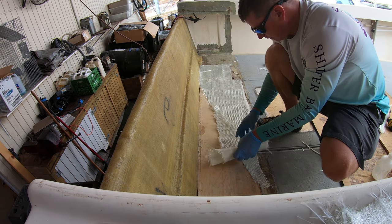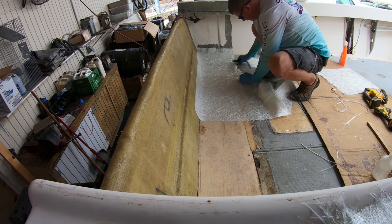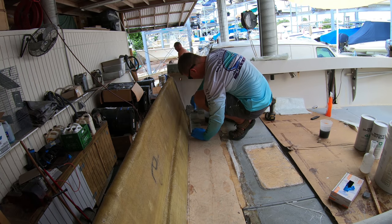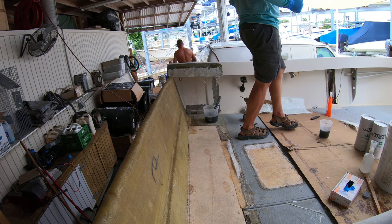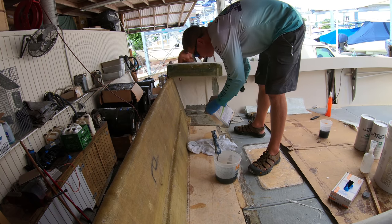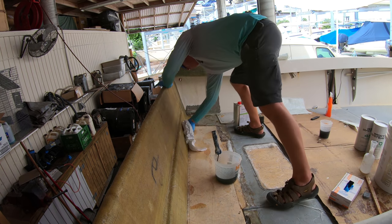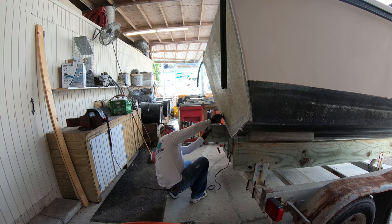All that's left before glassing is to cut out the mat that will cover over the woven once that's on the floor. We'll start by glassing up the side sections — wet out the piece, lay the mat on, screw it into place, then place the woven piece on top and get that glassed up. We'll do the same on the other side, then wipe down the transom section with acetone. The acetone will tack up the resin of the fiberglass to allow the new resin to stick to it. This only works if it's done only a day or two after the glass is just put on — if you wait too many days or weeks the resin won't tack up and you'll have to sand it to get any new resin to stick.